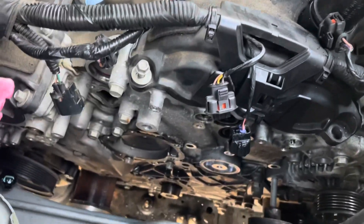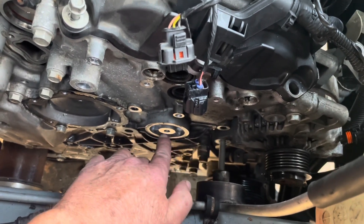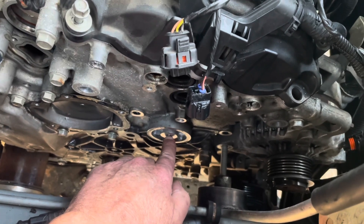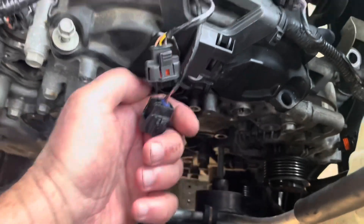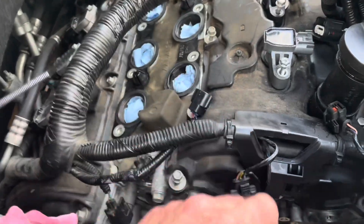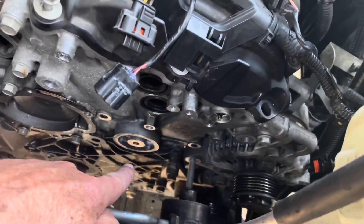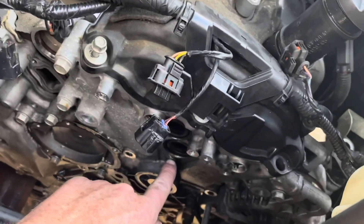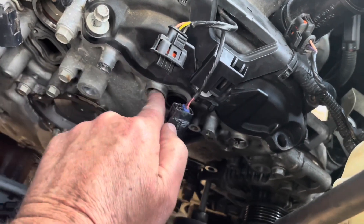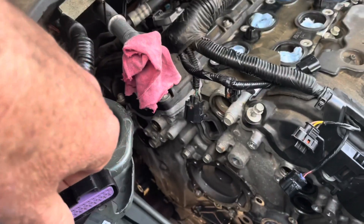Everything's stripped off the front. Another gotcha is the tensioner pulley was bolted right in there, and it fooled me — there was a bolt in the middle. I thought if I took that apart, the tensioner would come apart, but that's not the case. The middle bolt was also holding the tensioner there. Obviously you have to take the sensors out — there are two camshaft positions per side. This is considered the left bank and that's the right bank back there. You have two solenoids and two cam sensors per side, and the cover will definitely not come out with those in there.